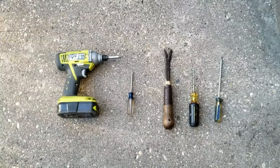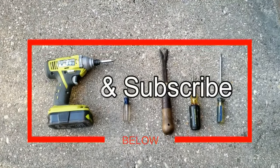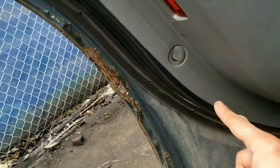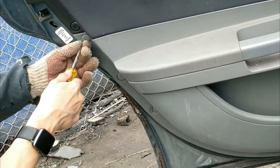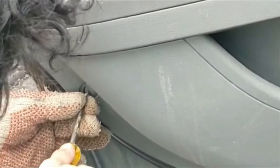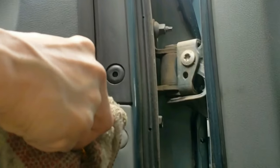If this video helps you, please like and subscribe to continue to learn the best ways to fix your car yourself. First, locate all six of these circular clips near the edge of the door panel on both sides. Grab a pointed tip and very lightly push the center of the clip. Do it slowly — you do not want to push the clip in all the way, as you will lose the center tip inside the door. So take your time and lightly push it.